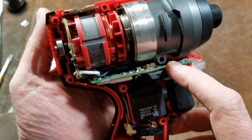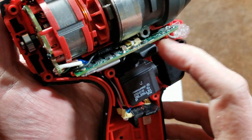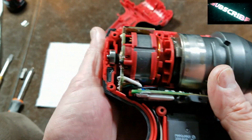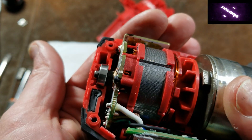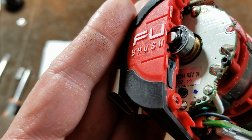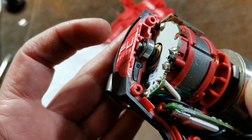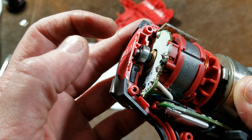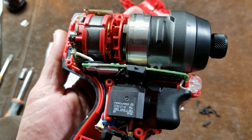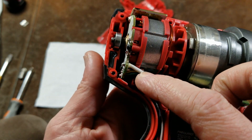There are just so many wires going in and out of the trigger. Here's the control board — this is where Milwaukee had to place it. It isn't epoxied, but it is conformal coated, meaning there's a layer of lacquer over the whole board. Not quite as heavy duty as the upper switch — you can see where they actually put glue on the back of the switch and all its circuits for extra protection. It's nice to see a rubber-sealed ball bearing with an E-clip, so if the bearing needs to be replaced you just pop off the clip and pull it off by hand. This little aluminum piece is the heat sink over the power transistors, right next to the wires going directly to the motor.